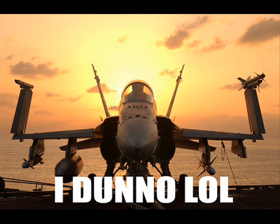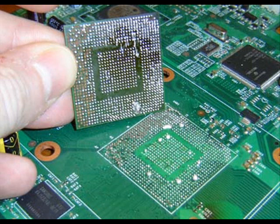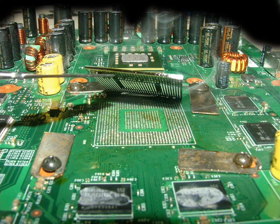The idea behind wrapping your Xbox in a towel comes from the thought that this error is usually caused by a faulty ball grid array, which is used to solder the GPU chip. Stress cracks, air bubbles, or other issues may arise in the soldering, causing the connection between the GPU and the motherboard to be faulty, leading to your general hardware error.